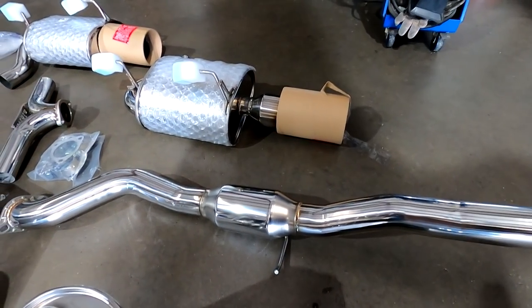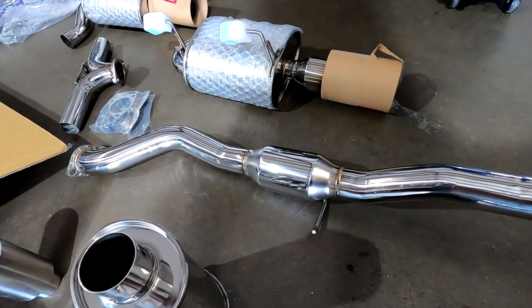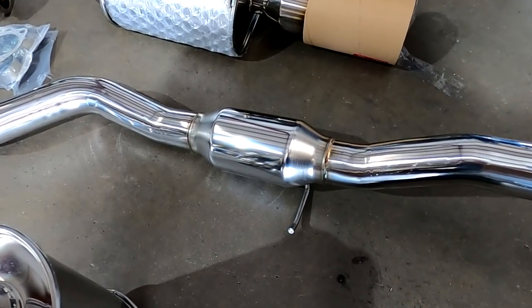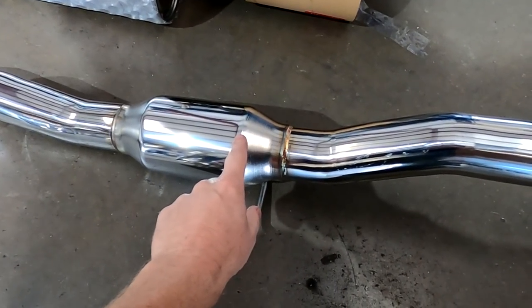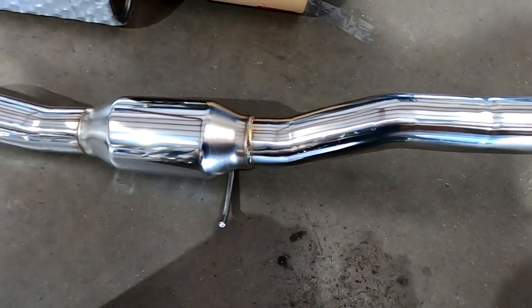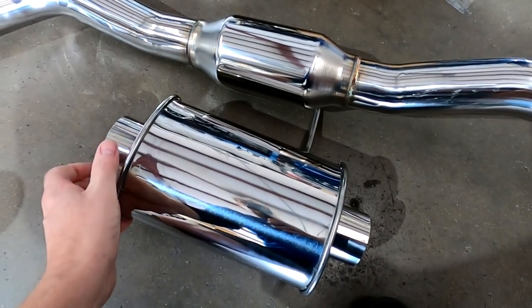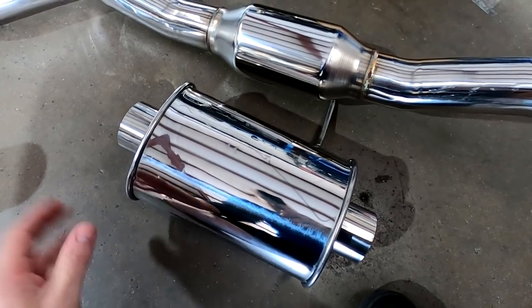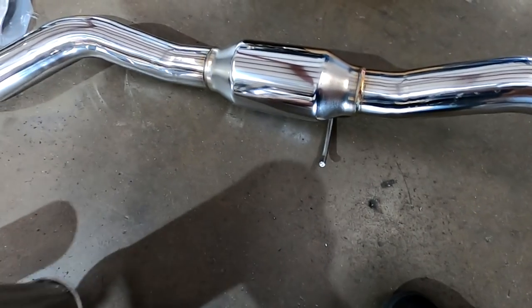This piping is 70 millimeter — a good size pipe. The weak link is this inline resonator — it's a little bullet resonator that doesn't really do a whole lot. It's too small; if you look at the inside diameter versus the outside, the actual material packing area is minimal. So we're going to change it to this much larger resonator — about 300% larger actual area — which will do a much better job taking away sound. It takes a little bit of work to fit but it's the right size.